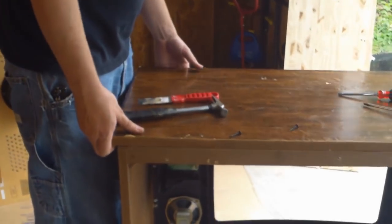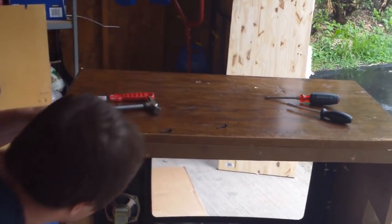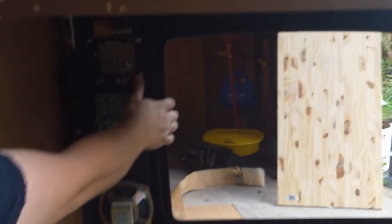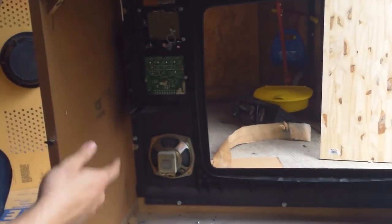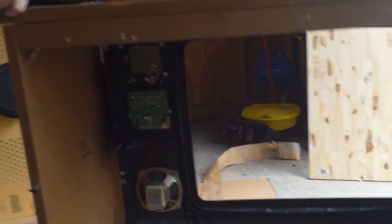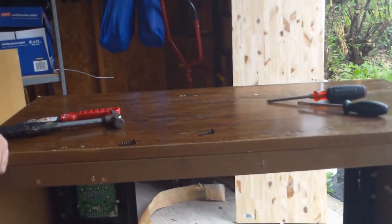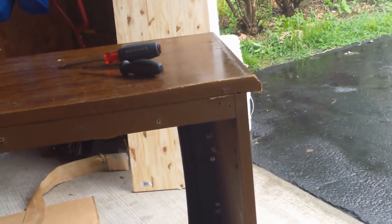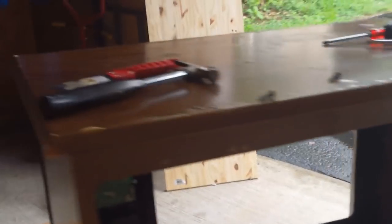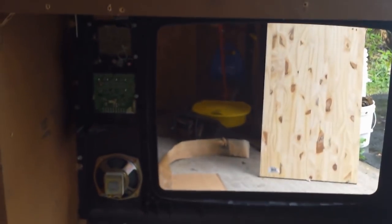Sometimes there are little triangle corner supports with Phillips head screws — make sure you get all of them. Generally most TVs have screws in the front going into the top of the lid to hold the two pieces together. To get to those screws inside the lid, you have to move the entire black frame. Once you have those removed you'll have a wooden box with four sides and nothing else. Not every TV is the same — some high-end RCA TVs had dovetailed wood, so I had to saw through a couple of spots to get the lid off.